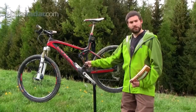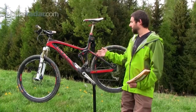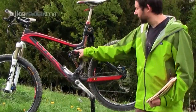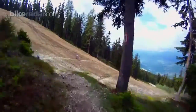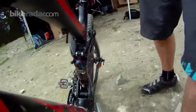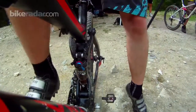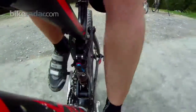We used just bolts in a stock shock, but that helped us package the bike so that we could make it as light as possible. At the same time we use a really short link — this is what we call the control link up top here — and that really short control link lets us have a leverage ratio that's pretty progressive in the beginning of the travel compared to most other four-inch bikes, packaged with the main pivot location and the levels of anti-squat and braking neutrality we've designed in.